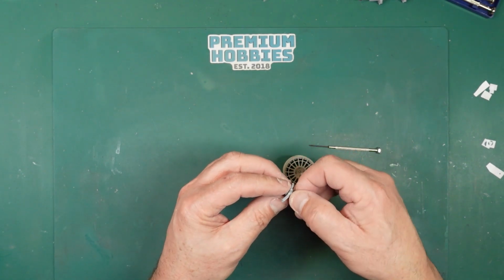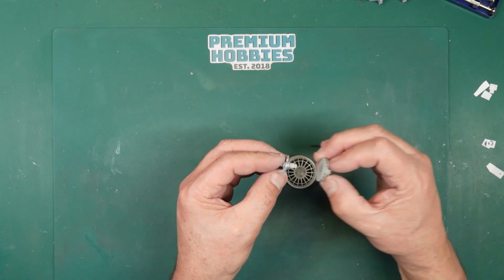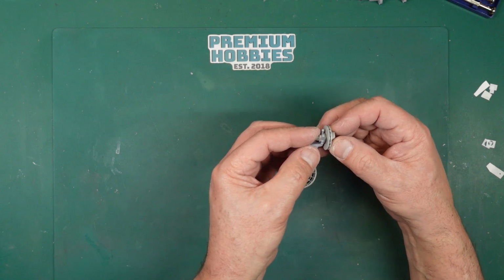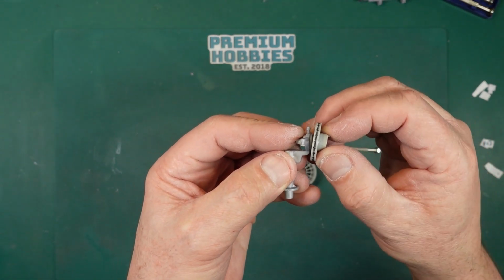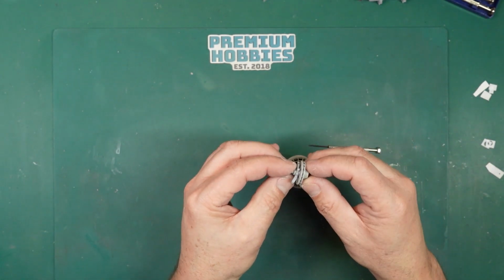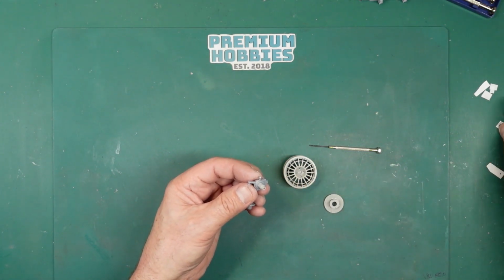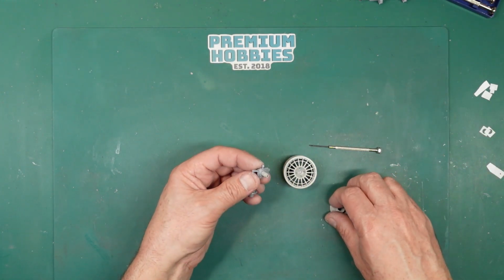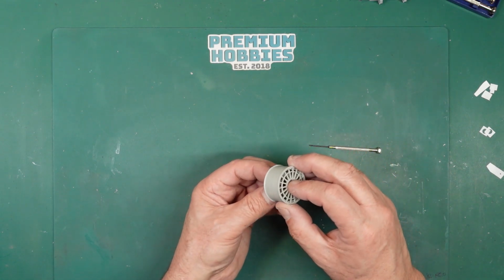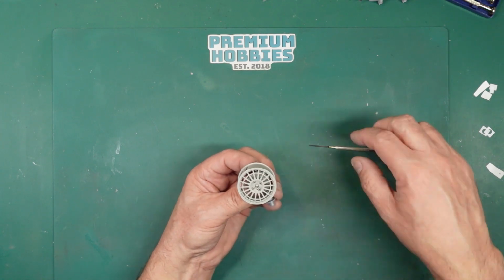So what we need to do is get something behind the disc, so that when we pull the wheel on, we're pulling the disc into that hub. So when it's rocking, exaggerated, what it's doing is this. Yeah? So if we actually take out that gap and remove any play, it should pull up tight. So I've got a couple of bits of plastic card here. In fact, what I'll do, I'll show you on the rear one, because I know that I've got the card sized to sort it. This isn't just something I'm doing fresh off the bat.